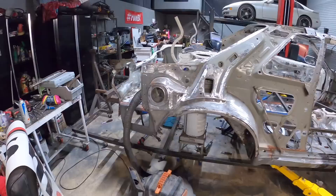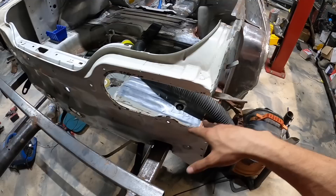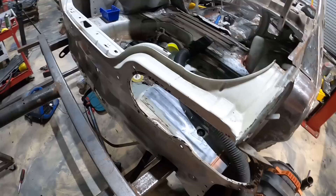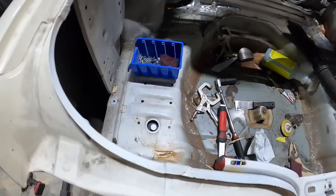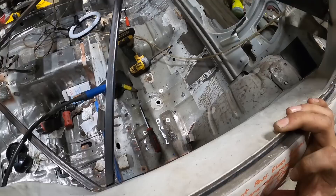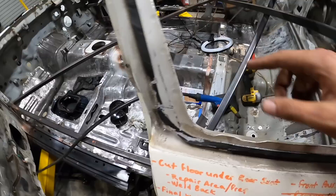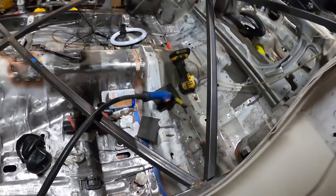Quick update: I bolted up my rotisserie jig for the back because this rail was positioned exactly where it came from when we put it back in, so that's a good starting point. This square section here fits directly and perfectly inside the chassis — it's a pretty nice snug fit and they kind of bottom out at the back ends. I've got a few spots all zipped up with some tack screws, everything is looking good. This is exciting — it all lines up good, connecting up with the floor rail up front. No more talking, let's get back to working.